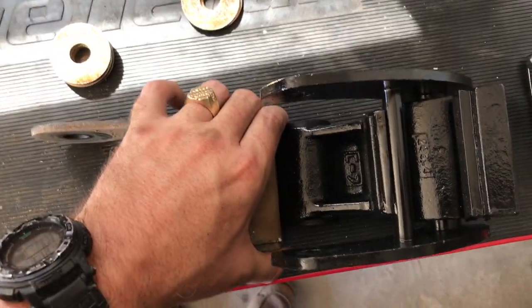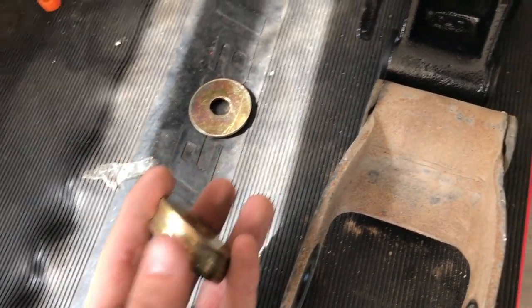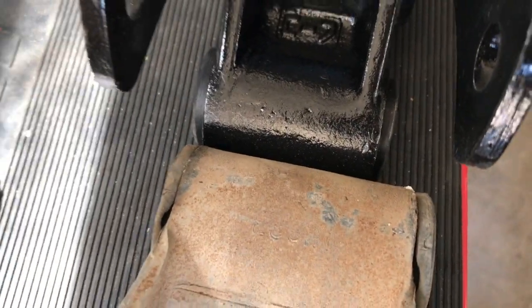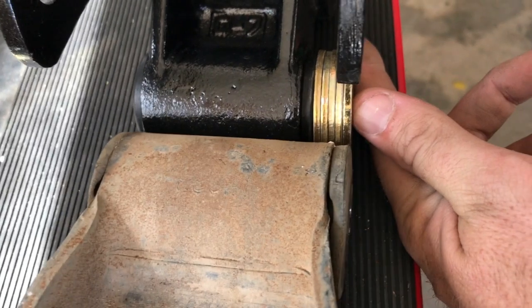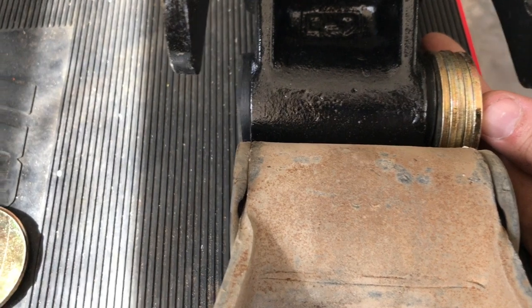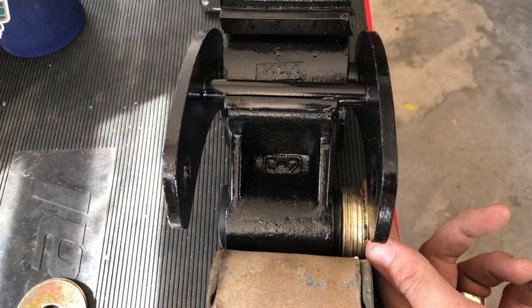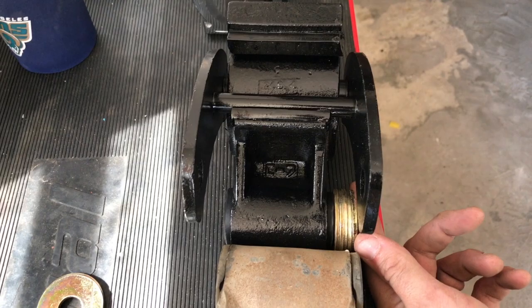No washers needed. All right, let's flip around and see about the smaller side. All right, we're going to line them up. They're not the same width. That's where these washers come into play that Sulastic sent with the kit. I got 5 here. What you do is you take the washers to make up this missing distance. So there you can see, it takes 5 washers to make it exactly as wide as the stock shackle. So when we install the Sulastic shackle, we're going to use these 5 washers to make up that distance so that the Sulastic shackle does not slide around.